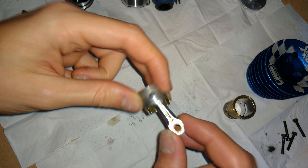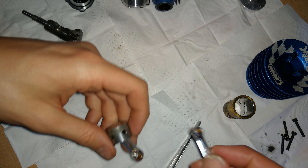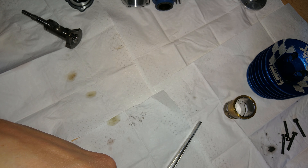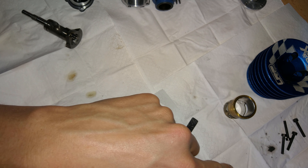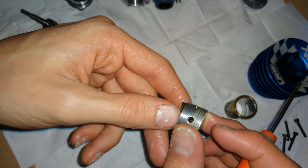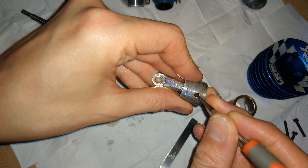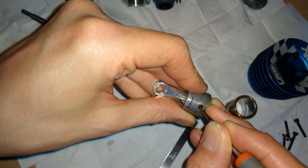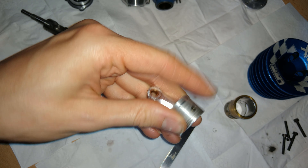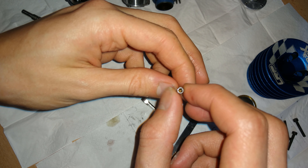This rod has two gallons on it. We've been running this rod since break-in and doing a lot of bashing with backflips, so I don't trust this metal anymore. We're definitely already six or more liters in. This is the new rod we're going to install. I already removed the clip — it's sitting right there. This particular LRP has only one c-clip; the other side is just blocked. Get a small screwdriver like this and just pull it out, then you can remove the crank pin.